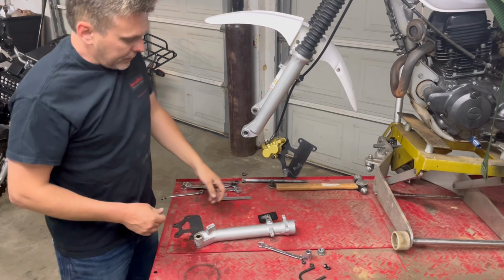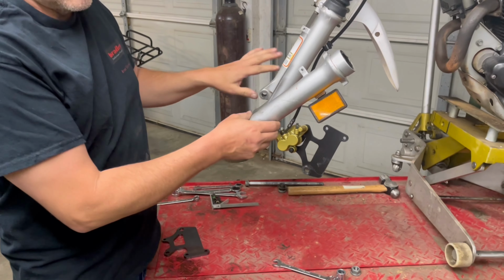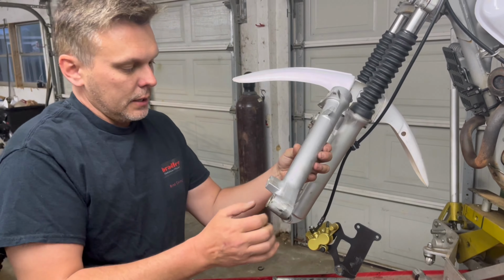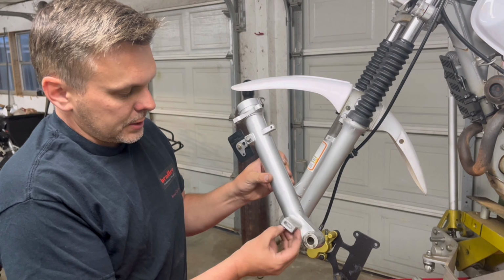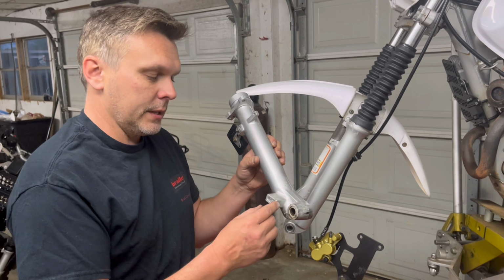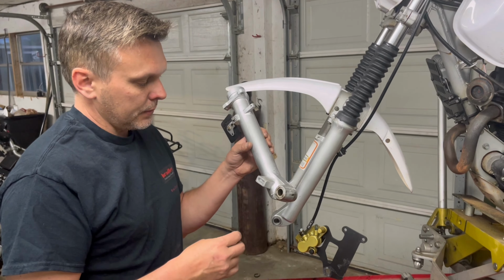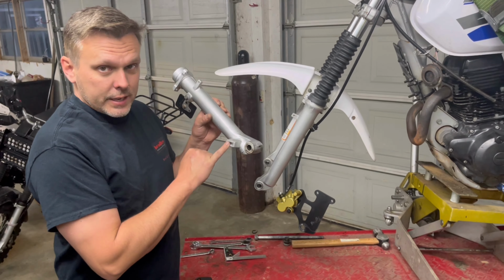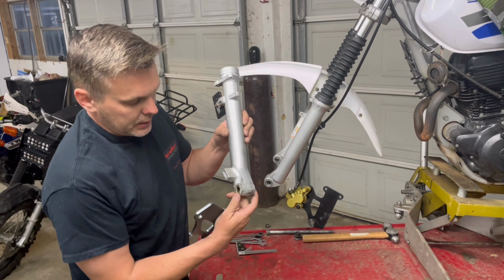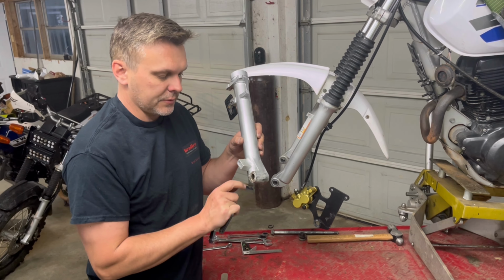Now onto this modification that we were talking about that's permanent. This is another old style lower left fork leg, and this lug or extrusion here is what is in the way that prevents us from adding the disc in there. So this portion here has to be removed. It has to be cut back at least this distance to this face.